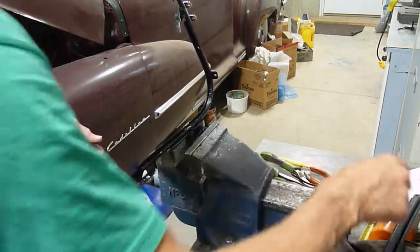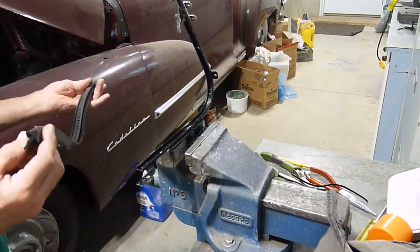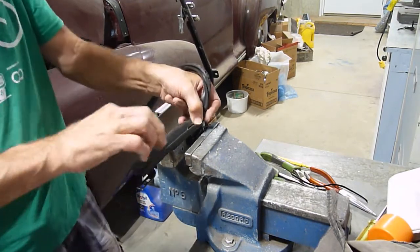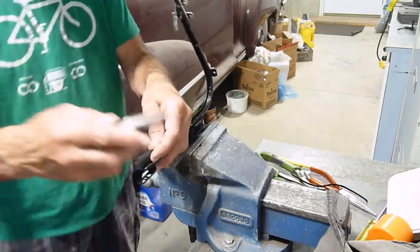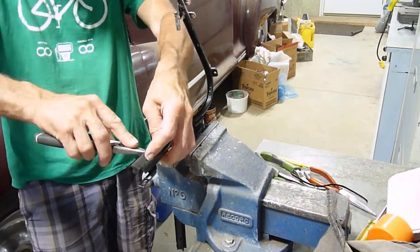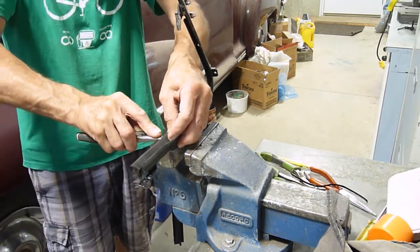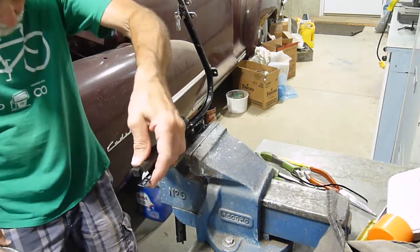It has retaining tabs on it there, the end. Those fit over the ends. So we're looking for the pivot, which is right there. This is the short end, so there. And that retainer tab there. So what I can do is lock it in tight. Now I can take a needle nose pliers, so it's fairly blunt. Now it says it's a needle nose, and shove the rubber in. You can also use a large flat screwdriver. I want something that's not going to puncture the rubber. Get it down inside the track. There we go.